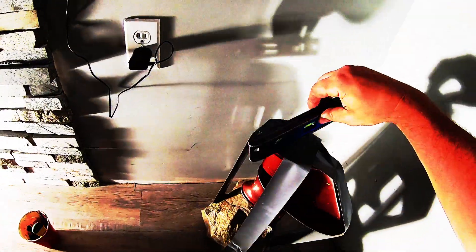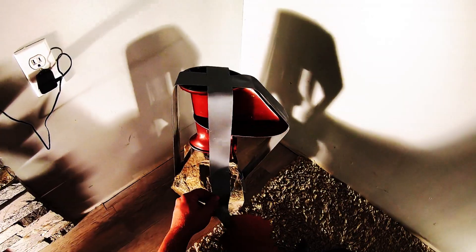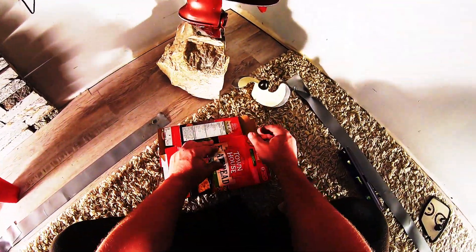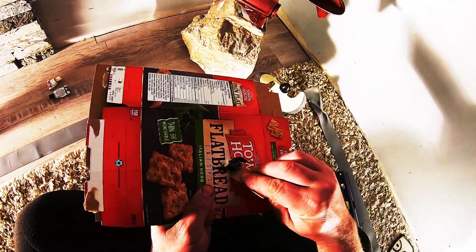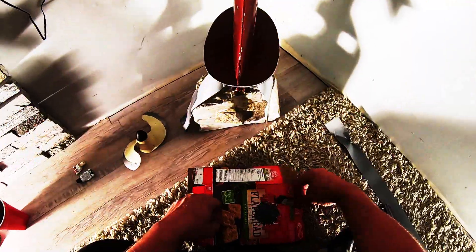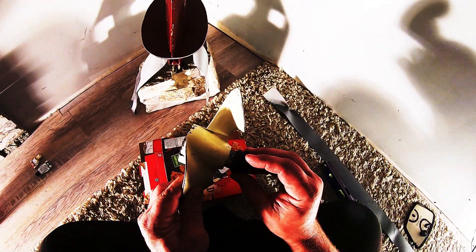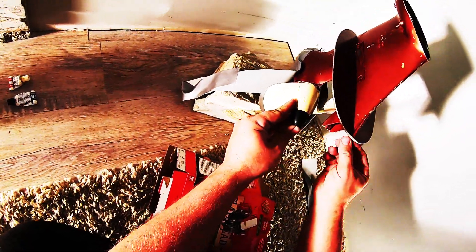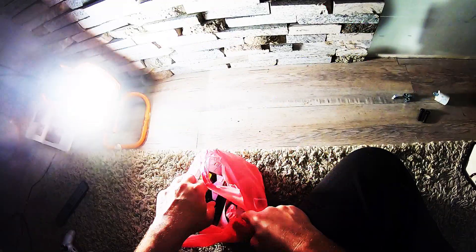Whatever product you're using, just make sure you're looking at the label. This particular anchoring cement takes about 30 minutes to set up. Now that it's set I'm going to remove the duct tape, and then attach the prop using a two-part epoxy — I'm using JB Weld. After working on Ryan's boat project we found that JB Weld is absolutely fantastic for gluing aluminum together. I'm going to put JB Weld on the prop and attach it back in its spot, and put the rubber grommet on as well. I'll leave it overnight — takes about 12 hours to cure. I prefer a slower-curing product because I find the bond is better and stronger in the long run.